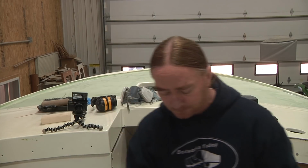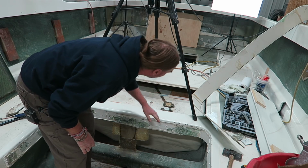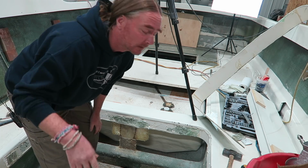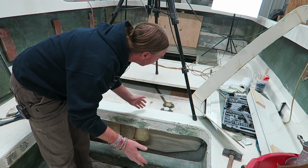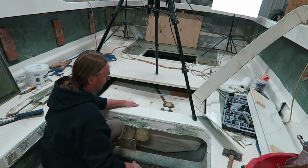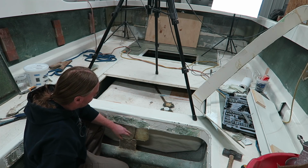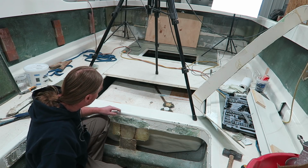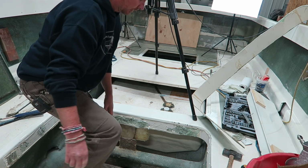The other thing I want to take care of is right down in here. Now this is the fuel tank right in here, which we'll be pulling out soon, probably a little bit later in this week, which will be next video. But I want to have the fuel tank in its own sealed compartment. So I'm going to take the tank out and put in a plywood divider on this side that'll tie into this rib, and also reinforce this because, well, whoever did this, this was their idea of reinforcing this top area here. And, well, here's how good of a job that turned out to be.